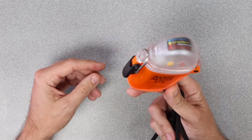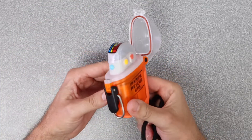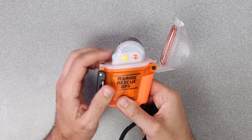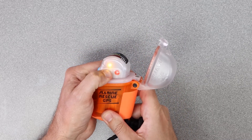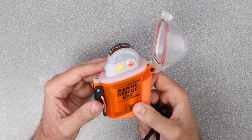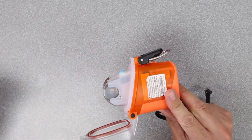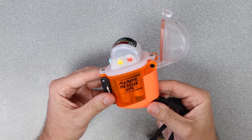There's a little battery expiration date you can attach on the back. To open the unit, just release the clip on the side. Inside, there are three buttons. The blue button turns the unit on — simply depress and release. The flashing means it still needs to be programmed. There's a yellow test button — when pushed it turns yellow, and if you keep pushing it, it'll flash yellow, telling you the battery life is still good. There's a red button currently covered by a plastic cap over the antenna. Once you release that, the antenna pops loose, giving you access to the red button. In an emergency, you push that button and it starts broadcasting your signal.